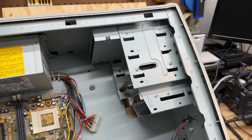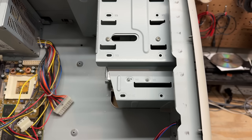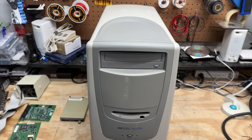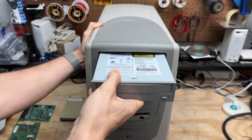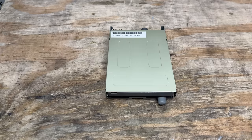Now let's see what's going on with those drive bays. I see a 3.5-inch adapter down there, so I'm pretty sure they didn't intend for you to put a 5.25-inch drive in that bay. Let's get this floppy drive out and pull the CD drive - that CD-ROM drive is made by LG. Gold Star is actually the G in LG, with the L standing for Lucky, so perhaps this drive is not so lucky. The floppy drive is made by Mitsumi, model D359T7 - a pretty common model, which is good because if it's hooped we can just transfer this custom door and button onto another one.